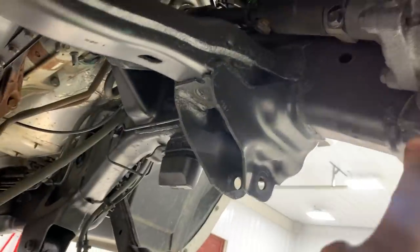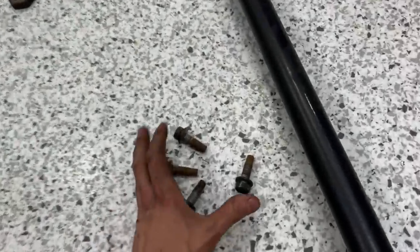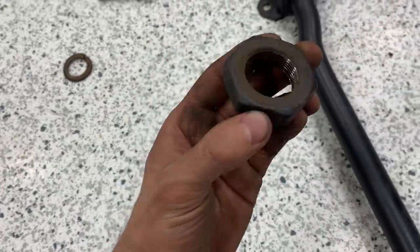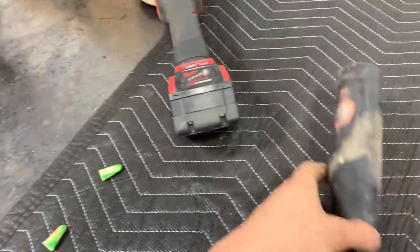As far as other parts that have come out so far — we attacked the steering first as the instructions say to do. The pitman arm came off, and the drag link connected to it was not as bad. The track bar is also out and off to the side. The drag link itself is completely removed and out of the way. They also told us to take the sway bar completely out of the vehicle, which makes sense — we have to put a spacer between the sway bar and the frame.